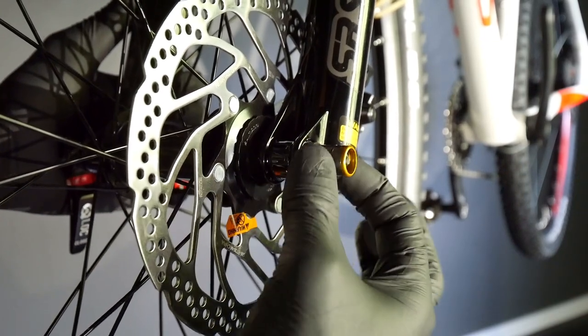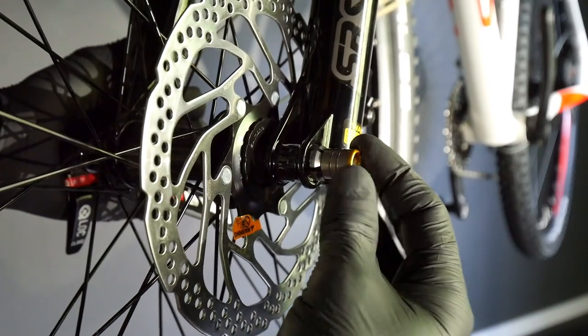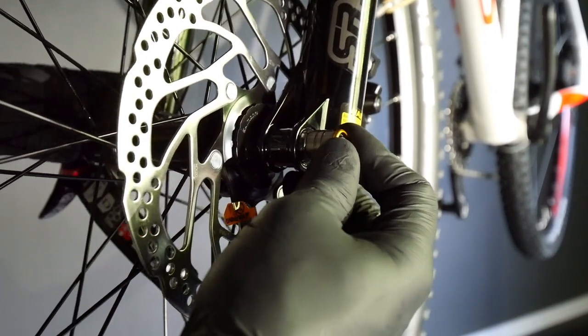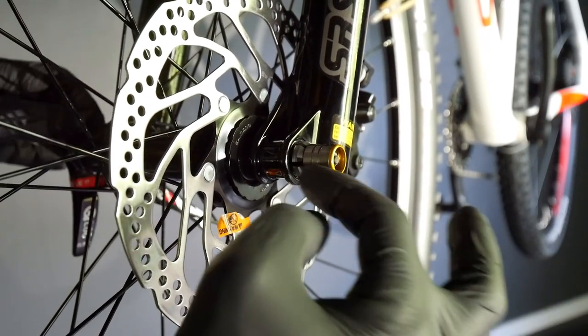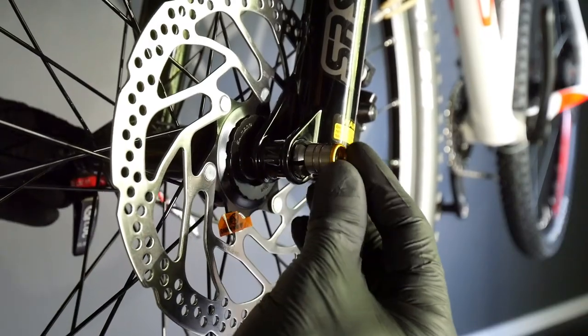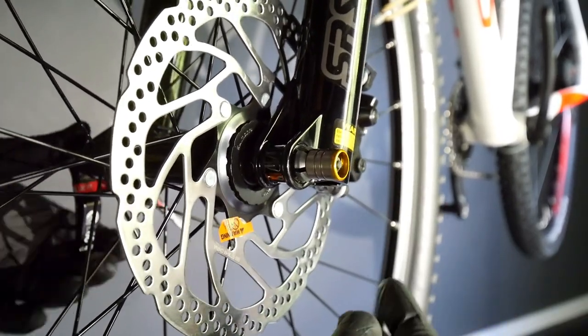Pull this part so that you can see it opens up. If it doesn't open completely, just maybe a little bit, it gets stuck here and you play with the lever — you might damage something, the dropout perhaps, also this whole system. So make sure it's all the way open.